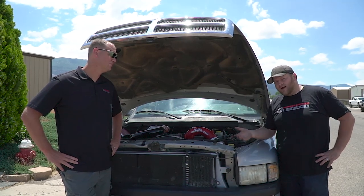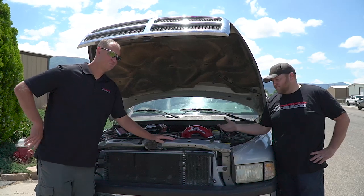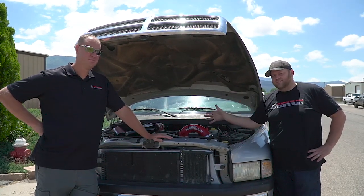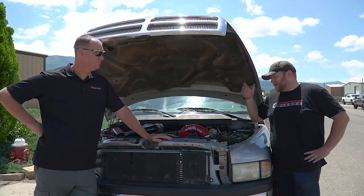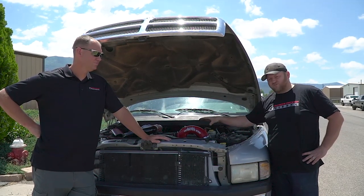There was a guy called Monster Pump Mike, and Industrial Injection had a Dragon Fire VP44. Nobody makes them anymore — they've all been discontinued. All you can get is a standard VP44. So if you want to race and run low 12s or faster, this isn't the best platform. That's why guys do P-Pump 24 valve.